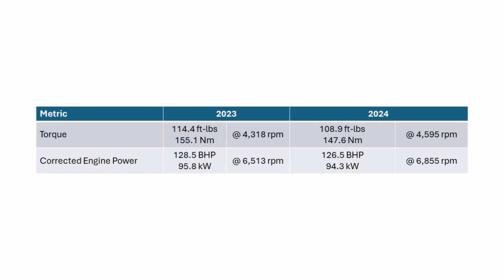And I didn't say that I did compression test the engine before I took it on to the dyno, and it was showing 195 psi on each of the 4 cylinders. There was a slight variation of 1 or 2 psi, but basically 195 across each of them.